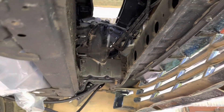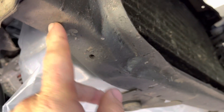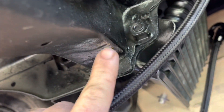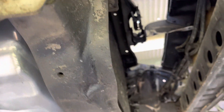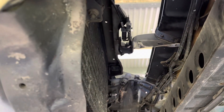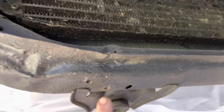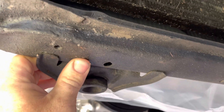Let's make some brackets and get it up there. We need to make a bracket to hold the intercooler first because it's a big boy - pretty heavy being bar and plate. You can see these are where the original intercooler pipes went up to that little bracket and over to the turbo, same sort of thing on the other side. We can go through here with our three inch alloy bends. I'll concentrate on making some steel brackets that go from here, using alloy on the top so it looks nice, and plate on the bottom going out to support the bottom of the intercooler.